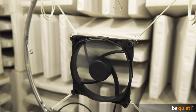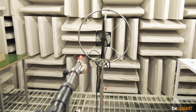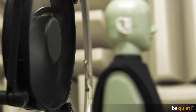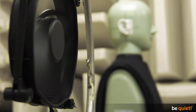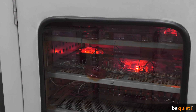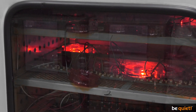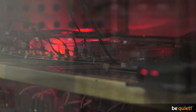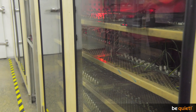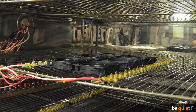The same goes for the noise the fans are making. This data is collected in an anechoic chamber which offers a background noise of merely 6 decibels. For comparison, a quiet room with perfectly isolated windows still offers about 30 decibels of noise. We used this incredibly quiet environment to make sure that our Silent Wings 3 never pass 16.4 decibels even at full capacity. And of course we want to make sure they stay that way as long as possible, which is why we put several fans into different chambers and make them run continuously for several months or even up to a year while performing a series of extreme tests and monitoring everything.